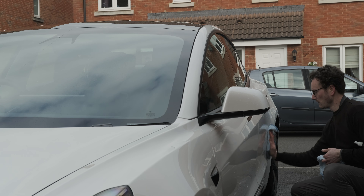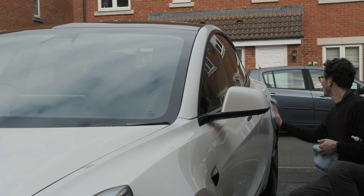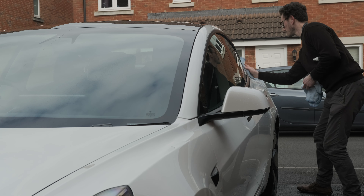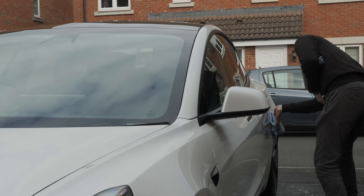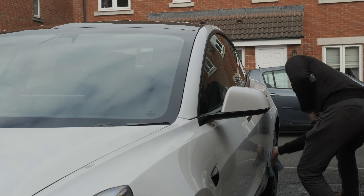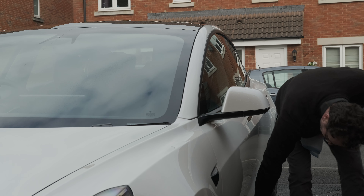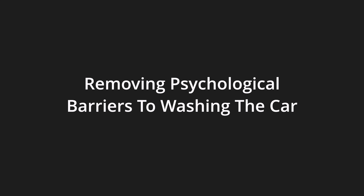You could do the same for the back of the car if it just gets a bit dusty. Usually for a quick top-up of a section of the car, I spray on a mixture of the rinseless wash diluted up to the quick detailer ratio — a much stronger solution — spray that over the area, let it soak a little, then use the proper sponge with the rinseless wash in the bucket. Then do the drying method after that. It's very easy to do just a quick top-up of one section of the car if you need to.